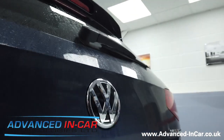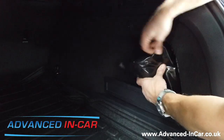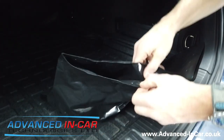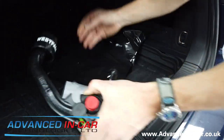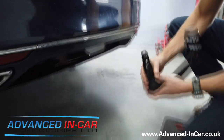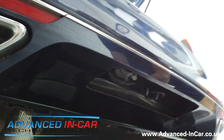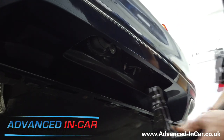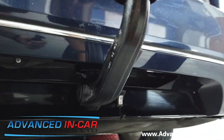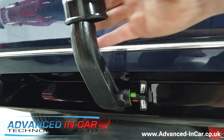Around to the back, give the camera a few seconds to pop back in. I'm going to open the boot. Nicely and neatly in the boot here is the Westphalia goodie bag — let's just pop that out. The tow hitch is already in the unlocked position with the key ready to go. To fit the tow hitch, we take out the little safety cap that stops dust and dirt from getting in, pop this in, and it's locked in — just as simple as that. Shut the little mud key guard, it's locked and won't go anywhere, and then we get a nice little Westphalia cap on there.